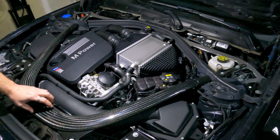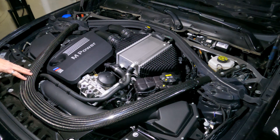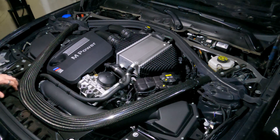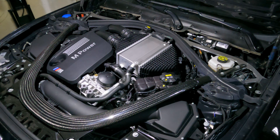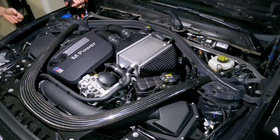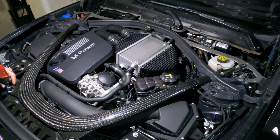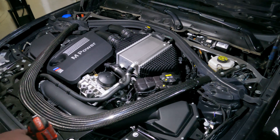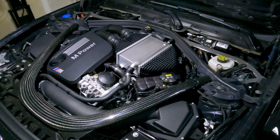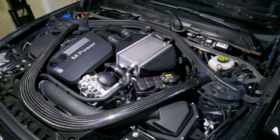Your strut bar itself - be really careful with this. It's carbon fiber and it's really expensive to replace. These 13 millimeter bolts: you've got the two long ones in the back, the two short ones in the front. I've already loosened them with my ratchet by hand because I want to make sure I have good, even pressure on them. This has probably never been off before - the car only has 19,000 miles on it. An impact wrench is nice for taking long bolts out. Also make sure to get that 10 millimeter that's still on the reservoir, which I've also loosened already.